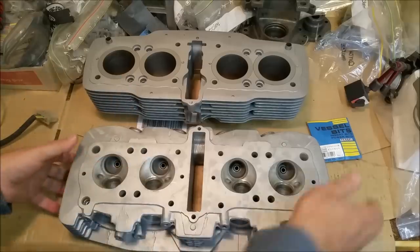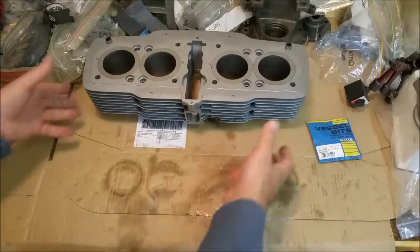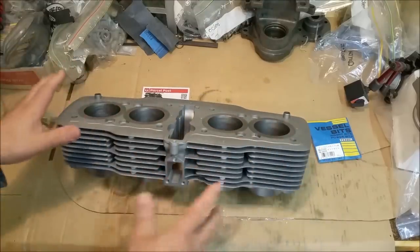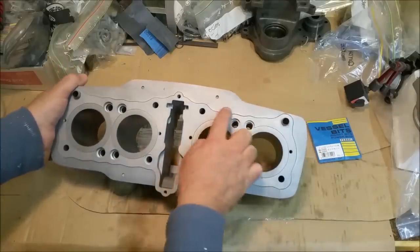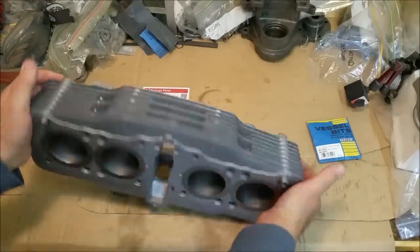The other thing I want to show you is the cylinders — the barrels or jugs if you prefer — and they are absolutely lovely. Now I re-honed this. The Hydroblasting has a peening effect, and I wasn't all that happy with the honing job I did on it. Those are casting marks by the way — they're not cracks.